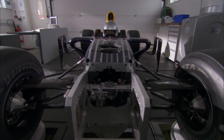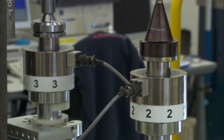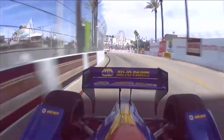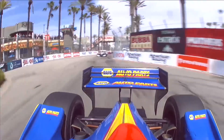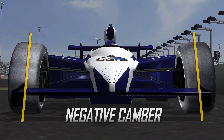We don't really tune the car much with dampers unless we have to. Generally, through our seven-post testing and simulations, we set the dampers for what we feel is going to give us the best and most consistent grip for the setup that we have, and we just leave it alone and tune the car with toes and cambers and things like that.